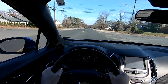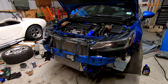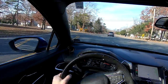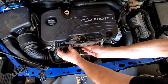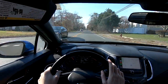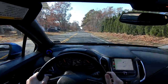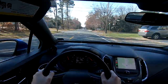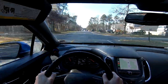This is really awesome because I'm getting to test out my intercooler while I'm at it. What's really cool about my intercooler system is it will also fit the Malibu — the 1.5 Malibu comes with a turbocharged engine much like the 1.4 Cruze, and my intercooler system will fit that car as well. I have an aftermarket wastegate on this car available at davescarstuff.com — between the wastegate, my intercooler, and my Bad News Racing tune, this car is peaking at about 25 psi. This intercooler is designed to work with a larger turbo and the factory turbo.